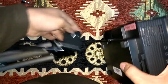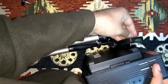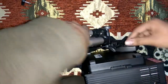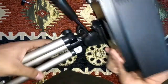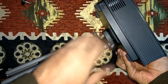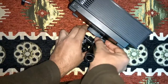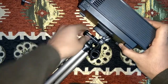Now you take the projector. Once you do it the first few times it will be difficult, but once you get used to it, it will be easier. Don't tighten it all the way — keep a little bit of slack so you can rotate the projector and turn it towards the angle adjusting handle so you can change the direction. Then tighten this knob so that the whole body doesn't flip over and fall. Once tightened, it won't move, and the flip motion is also locked.